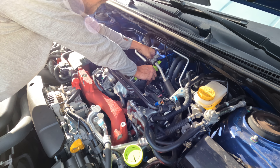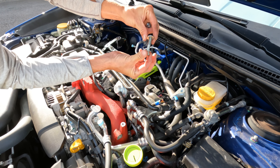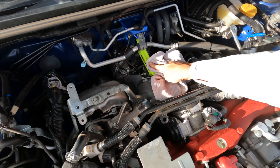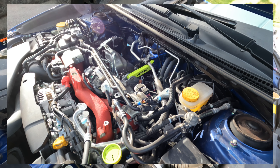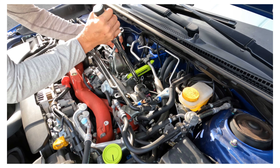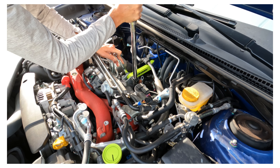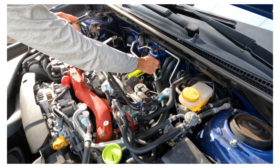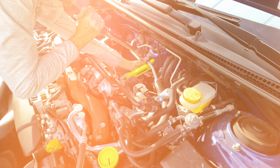Put the rear bolt back in — that one just screws in. Put this front bolt back in with washers on both sides. Looks a lot better, much sturdier. This front bolt is gonna be 37 pounds of torque. The rear one is going to be 43 pounds of torque.